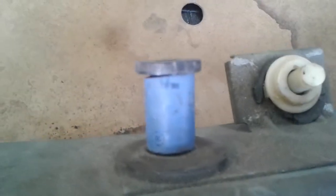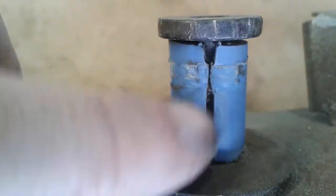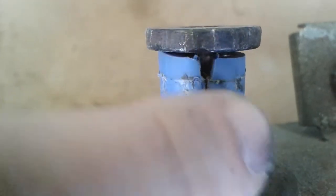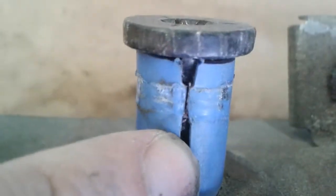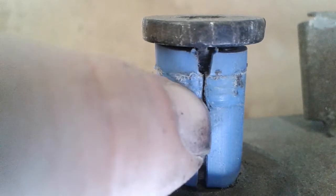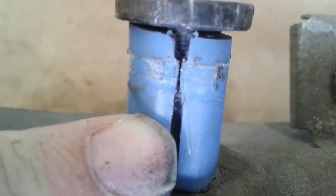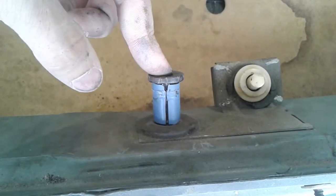PEX is extremely hard, so you need to cut a slot in it so you can work it around the metal striker pin. You obviously won't be able to get it on without having that slice through it. I used a Dremel tool — that worked perfectly. But you probably still want a normal drill bit to drill in through the center of it, so it's bigger around and fits this well.